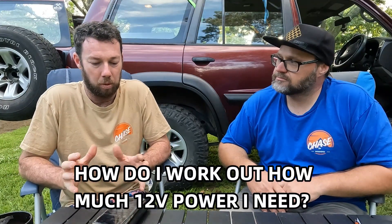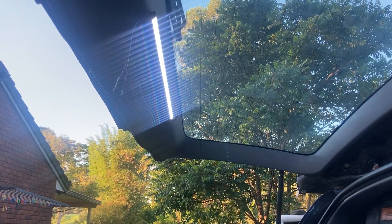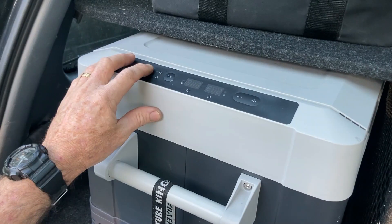How do you work out your 12 volt power requirements? It's literally a numbers game. Work out what you want to run and add it all up. When I'm designing systems, I go through appliances and expected run times. LED lights are anywhere from 2 to 5 amp hours and you'll have them on for a couple of hours a night. Your fridge may be rated at 5 amp hours, but camping fridges cycle about 50% of the time, so average that out to about 2.5 amp hours. Add it all up and that helps you work out what battery size you need.